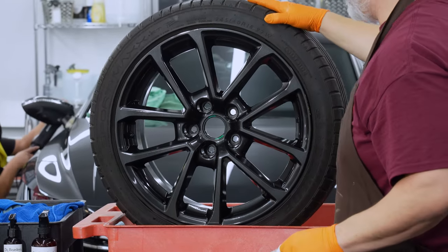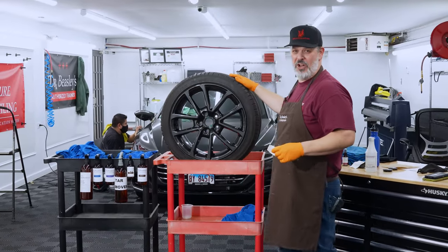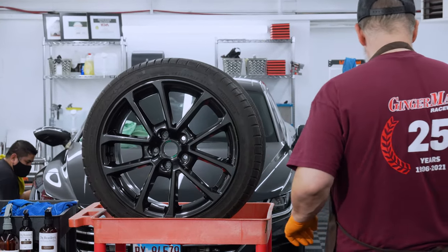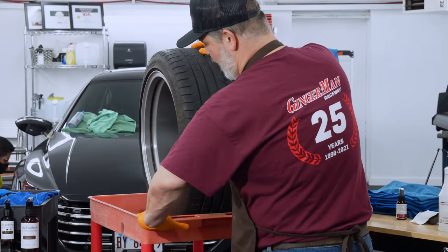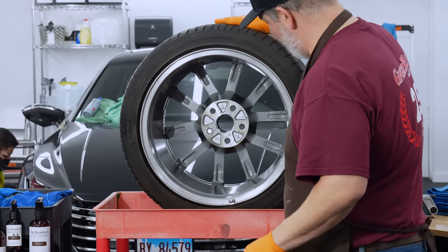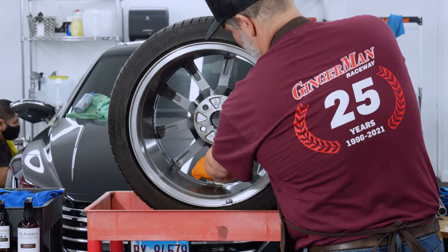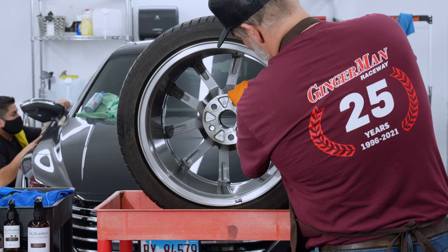Builder has been applied. Generally I like to give builder a little time to set up — half a minute to two minutes tops. Conveniently, working from the back to the front has already used up that time, so we're ready to apply the coating itself. I'll flip it back to the barrel — but first I need to level the rear side of the spokes too.